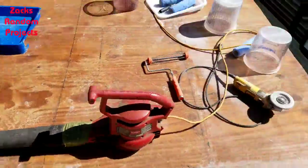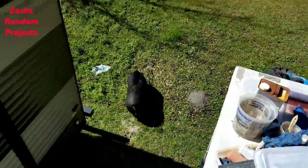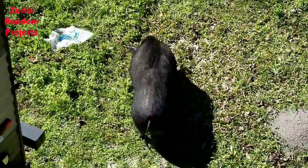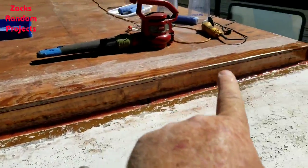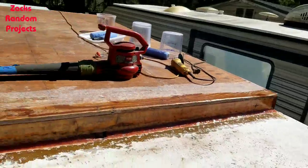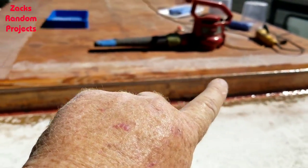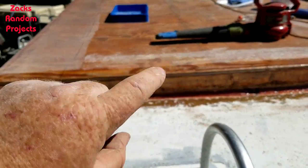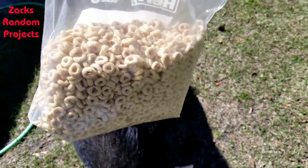The strip I just did is just about dry, so I'm gonna use this opportunity to hop off the boat, get a drink, and see the little fat baby dog - he's down there patiently waiting for me to come give him a little snack. I lied though - I decided before taking a break I was gonna paint that freshly sanded rear cap first. So I mixed up some resin and painted it on there, up over the edge and down onto the rear deck a few inches. While I'm taking my break, that wood is going to be absorbing the resin so it doesn't suck so much resin out of the rear strip I'm fixing to put on after break.